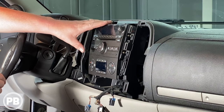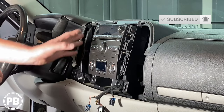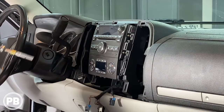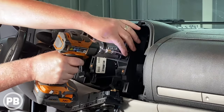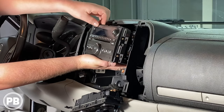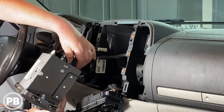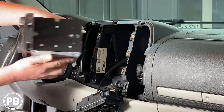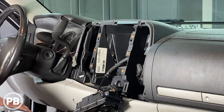What's left here is just the radio itself. We will have to remove the HVAC controls first, and then the radio can come second. All of which are held in with either seven millimeter or nine thirty-second screws. With all those screws removed, you can grab the radio and give it a tug — it should come right out. You'll have a few harnesses on the back of the radio; go ahead and disconnect all of them. Our radio is free.